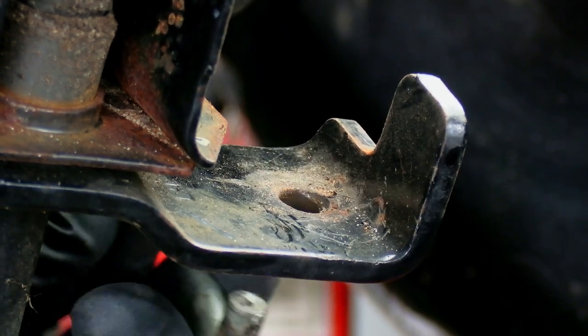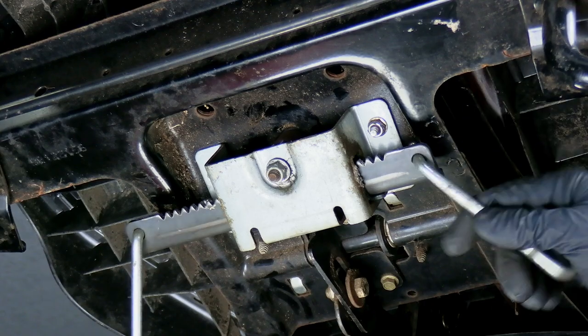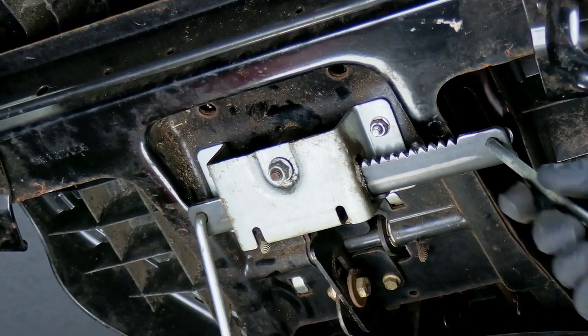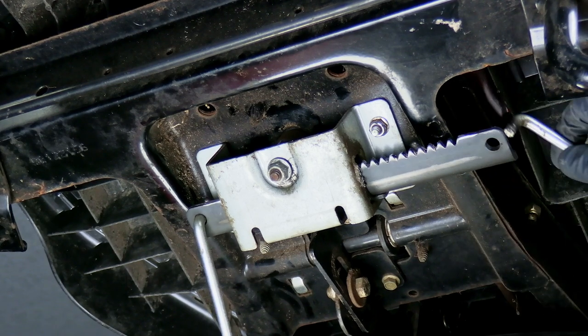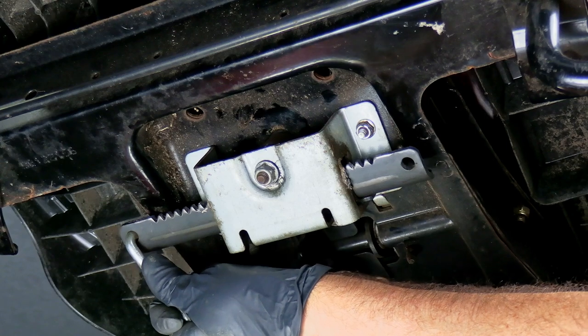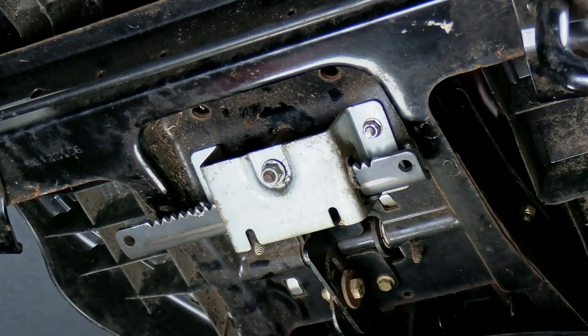Notice this comes right out. Now that we've got our cotter pins out, let's remove these tie rods. You'll have to pull the rack over or have somebody turn the steering wheel and just move it up like that. Keep this one on this side of the tractor and the other one on its side.